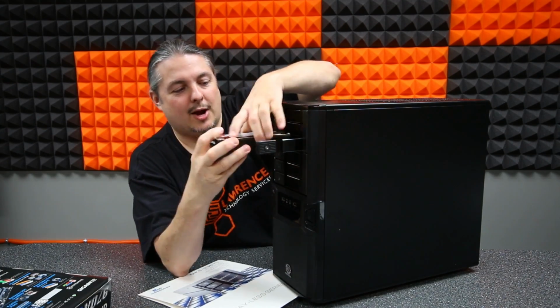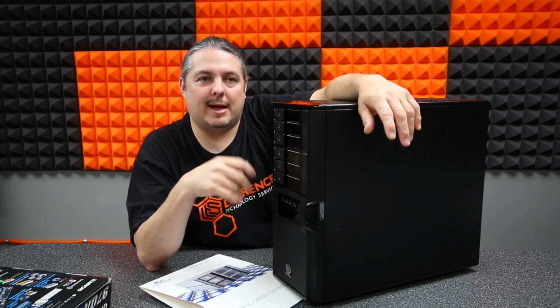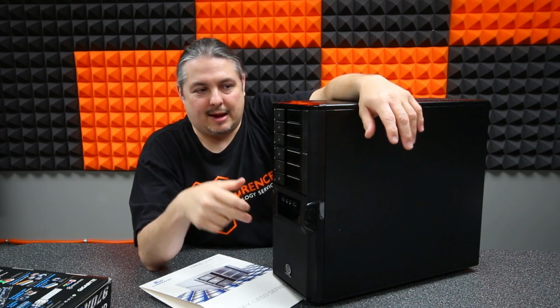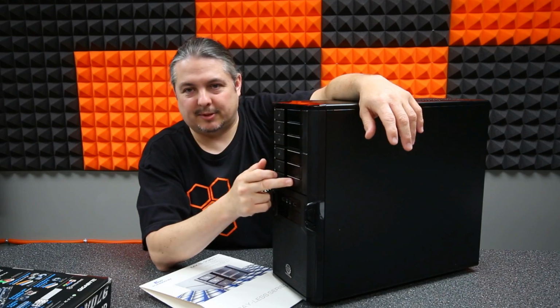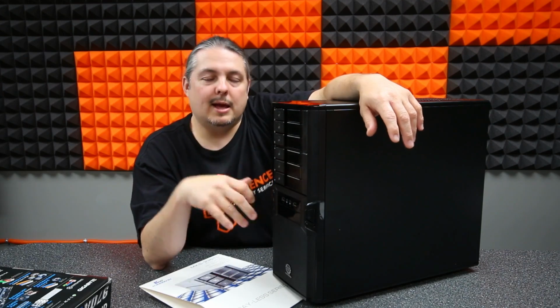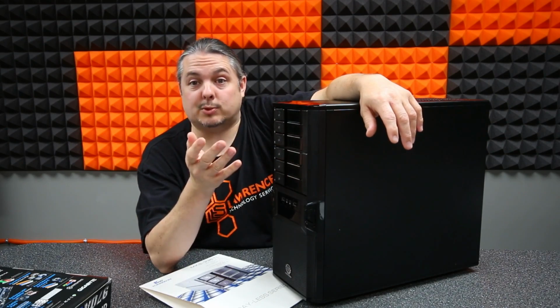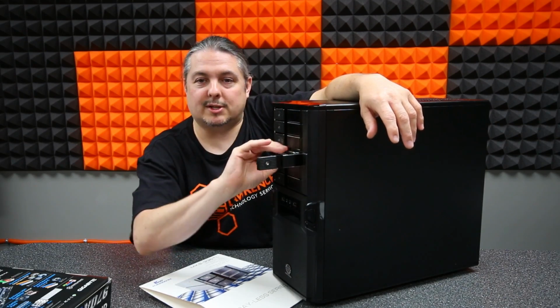Now, the way we number the drives, to keep it simple, there's 6 SATA ports, and they're referred to as ADA 0 through ADA 5. So we just started at 0 at the top, put the 5 at the bottom, and we know which one. So if FreeNAS identifies a drive as bad, we know exactly which one it is, and we can find it in the dock. Now, these docks are hot swappable as well, and you can do that without restarting the machine.